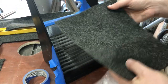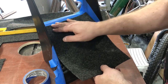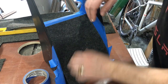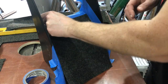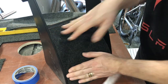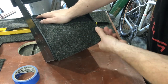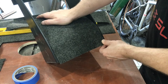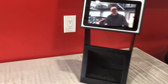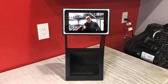Now it's a little bit of upholstery time. I'm just using some leftover speaker box carpet — I think it's marine carpet. It's easy to work with and it's durable, and it's applied with contact cement. You just want to make sure that your contact cement is dry before you apply it — it always works best if it's dry; if it's wet, it won't stick properly. So I carpeted the back, and then as you can see here, I also carpeted the inside, which I think just gives it that finished look.